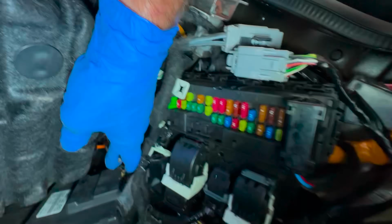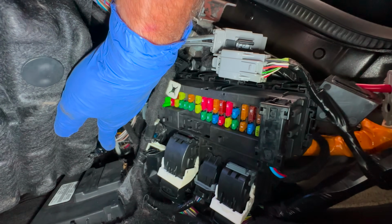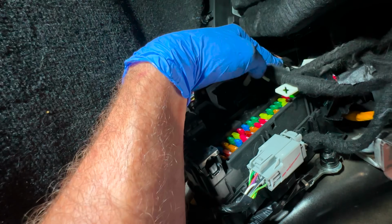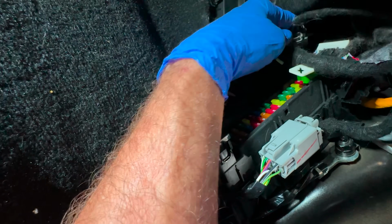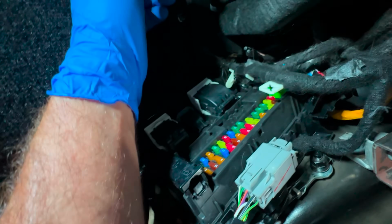That sparks my curiosity. All right, upfitter, pass-through wires. Sorry, pass-through. Here they are. You can see those 4 bundle right there. See them? Match up the same color that you had underneath the hood, because that is going to denote what circuit you're going to be on. And that is really perturbing me. Where the hell, for one, did that come from? And if that was to be hooked up, what is that for? Weird. Never seen that before.